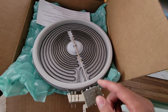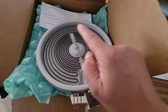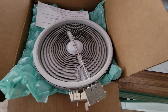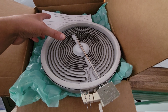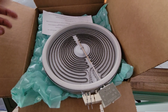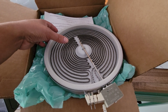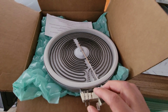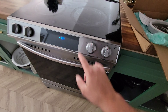I'm going to use gloves because whenever I touch this material it makes my hands feel weird. Also, don't touch the heat element with your bare hands — the oils will mess it up. The other burner burnt out right there, and my theory is that the installer grabbed it without gloves, putting fingerprints and oils on it. I could be wrong, but that's what it looked like.